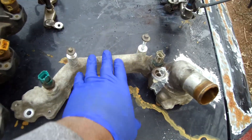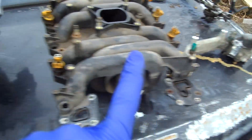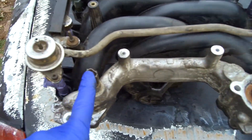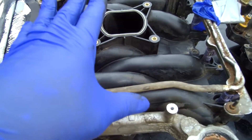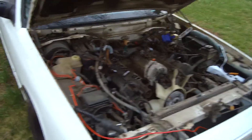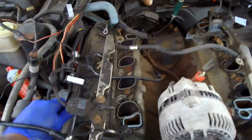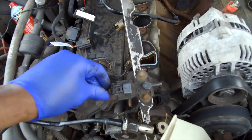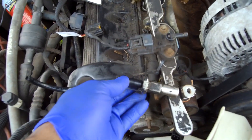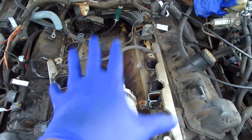On this non-PI head, we have two sensors here for the coolant crossover tube, and we have to be able to put this on our PI situation, which we see only has one. Also, we had to change the fuel rail because this is a return-style fuel rail on this engine here, and with the PI version it has a different fuel rail — as you can notice, this ain't going to work. This one has the electronic fuel pressure regulator and a returnless-style system.